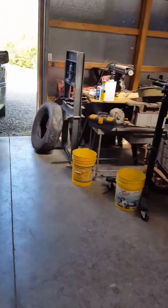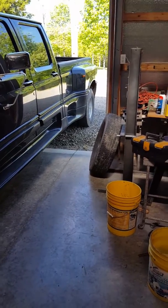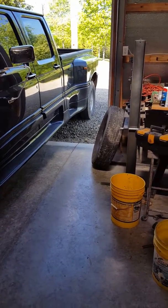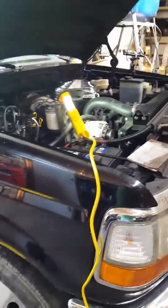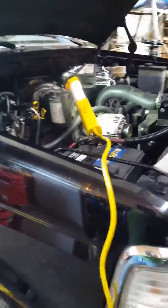I've been driving this truck for a week now. Brake pedal right where it needs to be. Just make sure you adjust your brake shoes up on your back axle, because some of these trucks don't have automatic wheel adjusters on them. Okay, that covers the brakes. The brakes are fixed. Air in the lines. About $395 later, with all these new parts and crap and headaches for 2 weeks, air in the lines. Trust me, air in the lines.